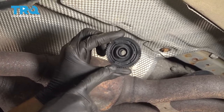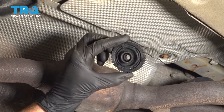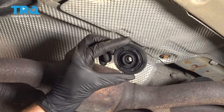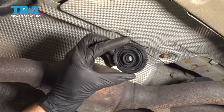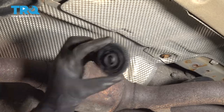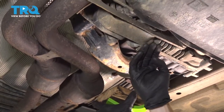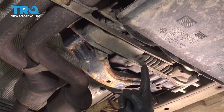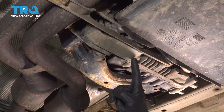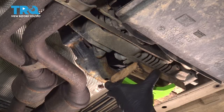Okay friends, it's time to get started on our replacement. This part is going to be located on the transfer case actuator motor. We're going to make our way under the center of the vehicle and access the motor itself. Once you're under here, apply some support directly underneath the transfer case. If you're using a jack of some sort, make sure you don't damage it — it's a good idea to use wood in between the jack and the transfer case.